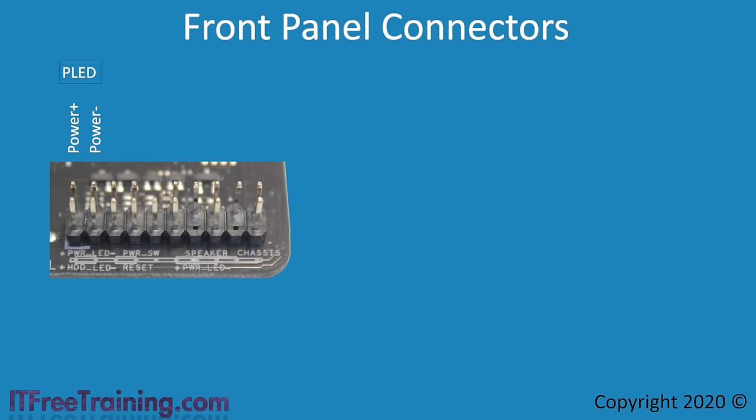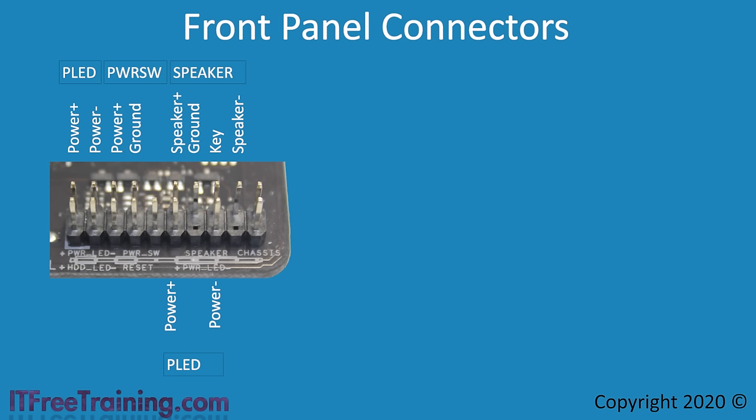You will notice with the power LED that there is a second set of two connectors. Most motherboards will have both two-pin and three-pin connectors for the power LED for compatibility reasons — on some older setups you may have a two-pin connector but a three-pin on the motherboard, in which case you can cut the two-pin connector in half. The next two pins are the power switch — there is a positive and negative connector, but with switches it does not matter which way you connect it. Next, there are four pins for the PC speaker; on modern computers only the outer two pins are used. Most speakers will still work if connected the wrong way, but it slightly distorts the sound, so connect it correctly.